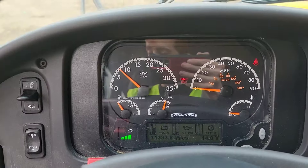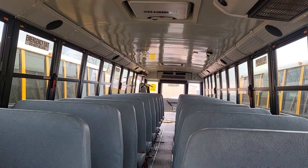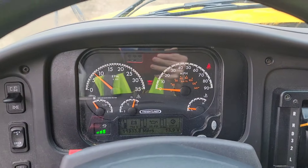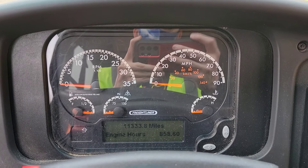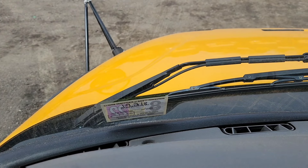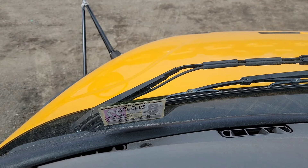Make sure you have at least a half a tank of diesel in the summer, three quarters in the winter. If you have DEF, make sure you have at least 25% — if the last light shown is not green, if it's yellow or red, do not drive the bus; go straight to the workshop to have them top off the DEF. Also, don't drive with the empty sign up — take that off when you get in the bus and put it back on when you're done searching for sleeping students at the end of your route, or when you're back at the barn.